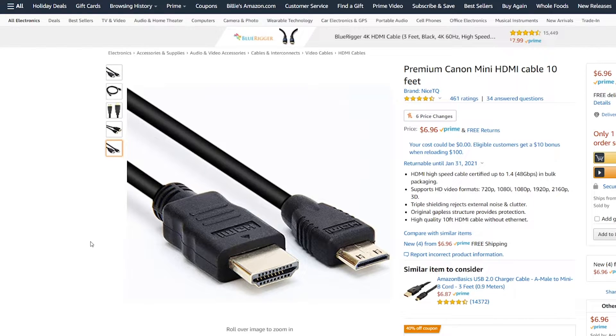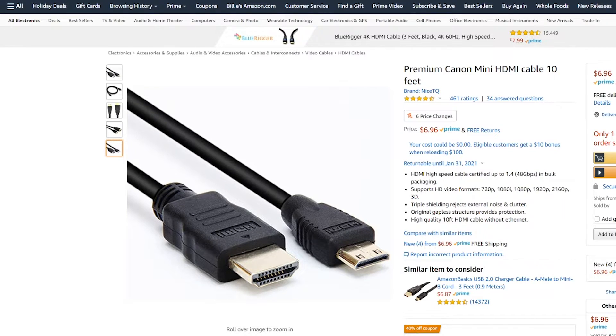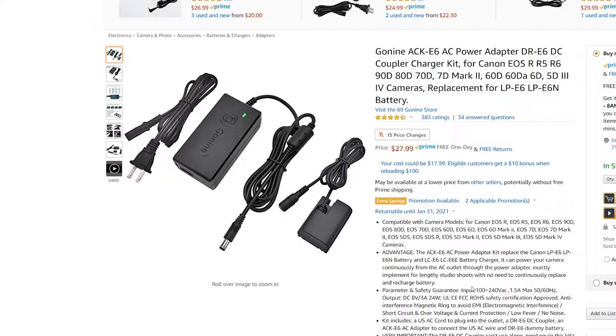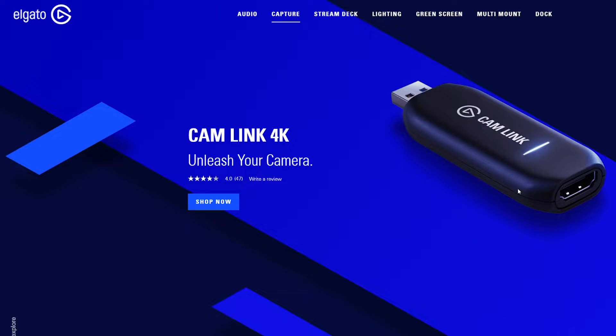One of them is going to be an HDMI to mini HDMI. This will plug into your camera, and this side will plug into the Cam Link 4K. I also recommend a constant power supply for your Canon 80D. You should buy a Canon branded constant power supply; however, I have used off brands before in my Canon 80D and have had no issues with it. Your mini HDMI will plug into the typical HDMI port on the Cam Link 4K, and that will go into a USB 3.0 on your PC.